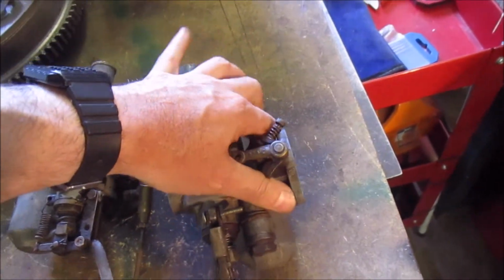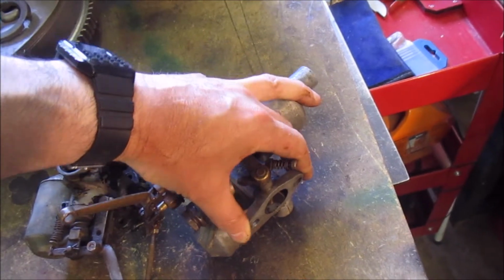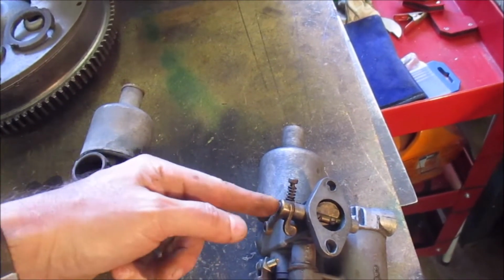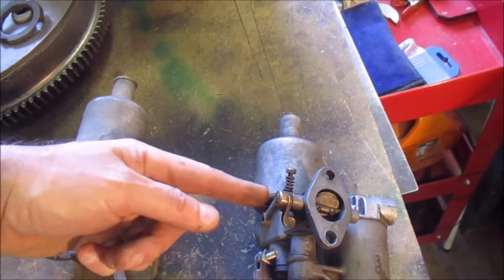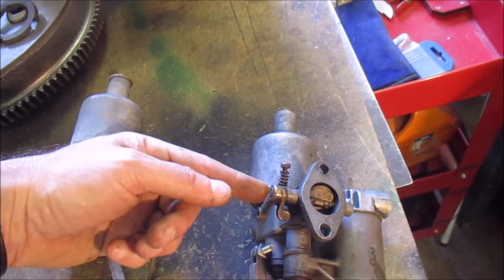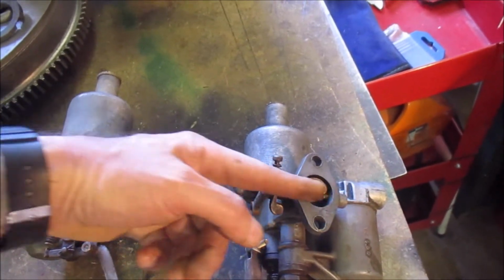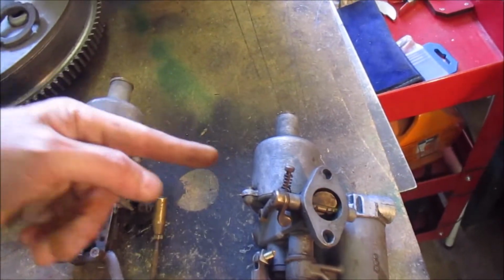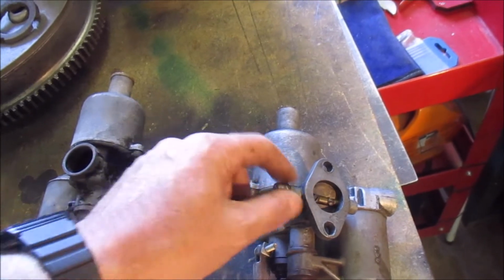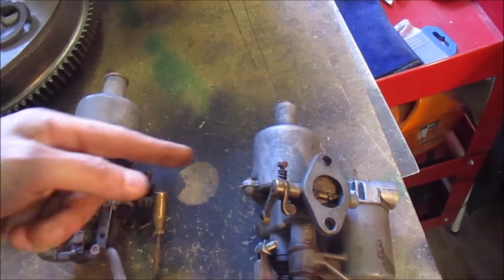Now I've got a mill to bolt this to, and then in the mill I could set it up so that there's a guide pin, probably a piece of drill rod or something, silver steel, that's in the collet in the mill, so I can get this perfectly perpendicular to the mill axis, and then all I need to do is get the appropriate reamer and ream these out so I can bush them, and then once that's all done, you sort of line ream it.